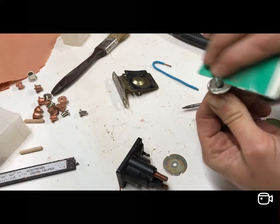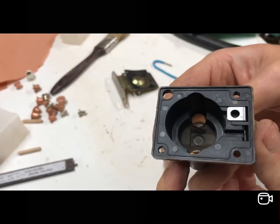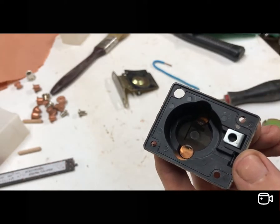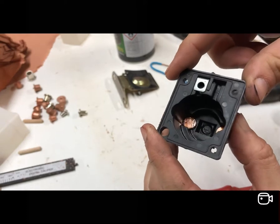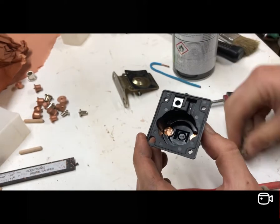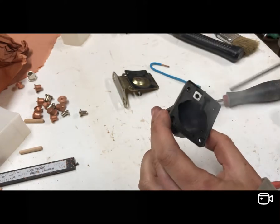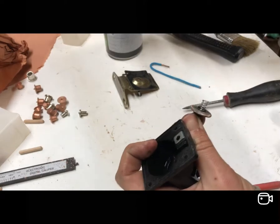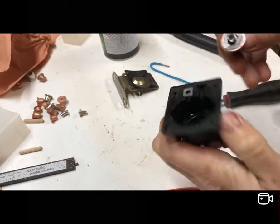Get it back to bare metal - I'll do that off camera. The same inside there - one is a bit worse than the other. So much cleaner now. All I've done is got a flat screwdriver in there and scraped off the burnt charred bits on the copper poles. Done the plunger as well, which is probably equally important as that was all charred up. I've put a little bit of electrical contact spray on both surfaces - not much, just a little bit - it'll help prevent buildup for a while.